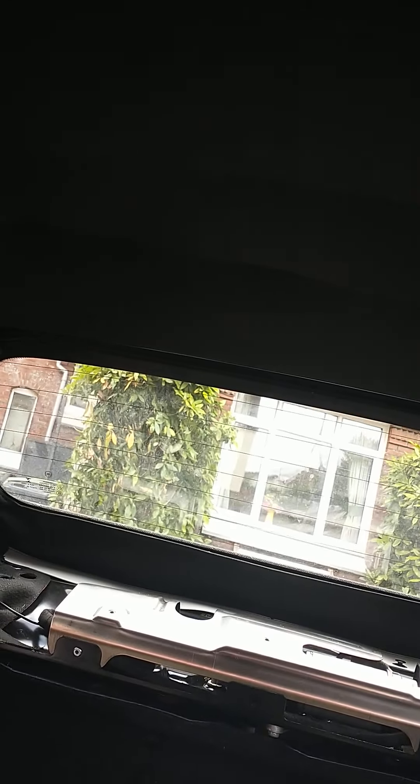I'm in the back of my wife's Fiat 500 Cabrio. She told me a few days ago that the roof wasn't closing, so I had a look and discovered that a pin had come out of the three-way linkage at the back — which you can't actually see from here, but I might show you later. This pin had come out, it's got a spring clip on the end, so the three-way linkage was completely separated, which means — she said — half the roof went back and half of it didn't.